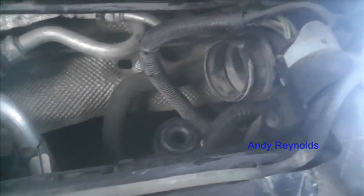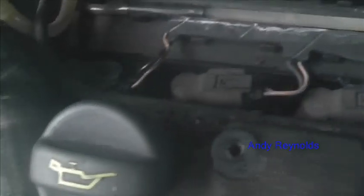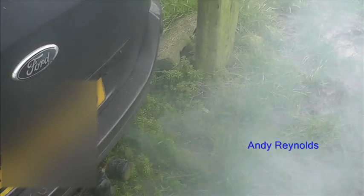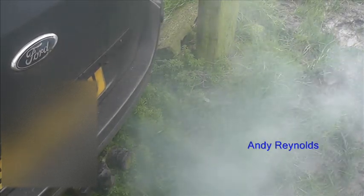There are the two rubbers that those pins sit in, and that pipe there feeds onto the air filter. Here we have the four injectors — it's common rail high pressure. You would not believe it. I removed the connector and I think I've pushed it back in — yes I have. I'm going to start the car up now and see how it smokes. It ploughs out smoke doesn't it. Now I'm just going to go and undo that number one injector.